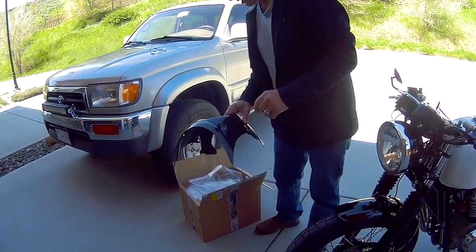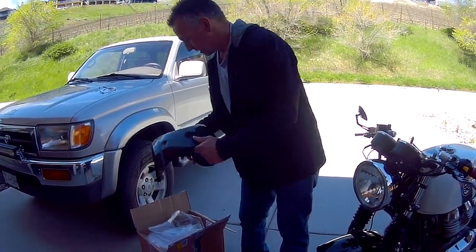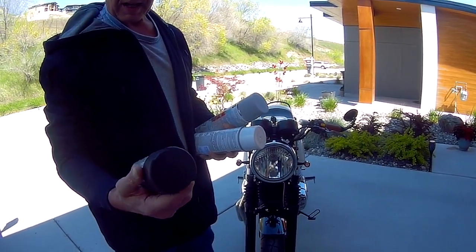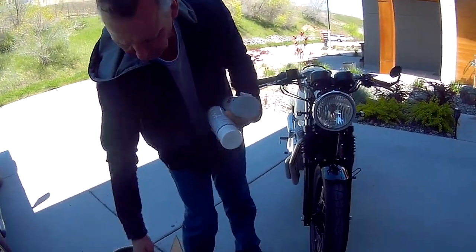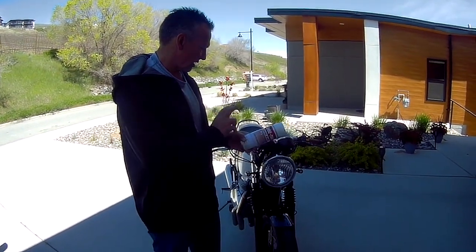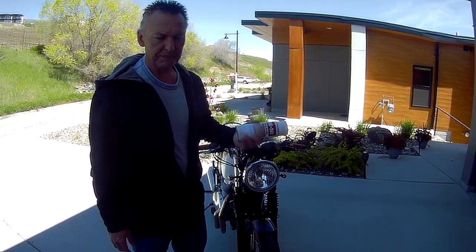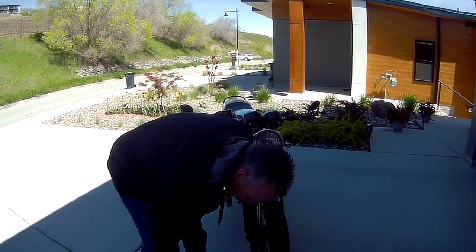What we've got to do now is paint it. I was going to take it to a paint shop — they wanted around $300 at a body shop, and I'm not going to do that. So what I've got here is some primer, black canyon black satin — a dull black. My thoughts are I want the inside of the fairing black, and then the outside in white, the Ice Queen. The paint code for Ice Queen white, which is also the paint code for the Baker Express white, is RAL9010. I went to my local auto body shop and they package it in a spray bomb for you for about $40 Canadian — probably around $20 in the States.